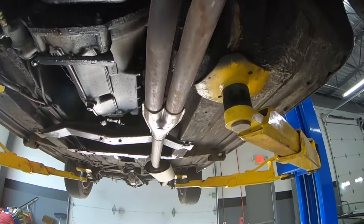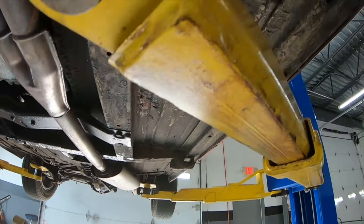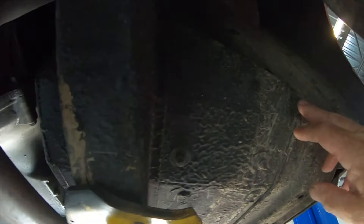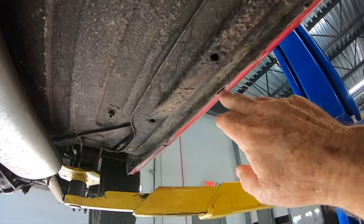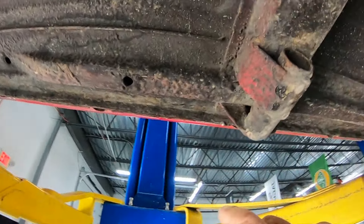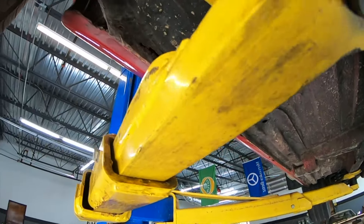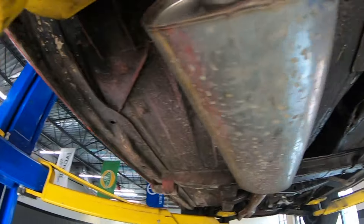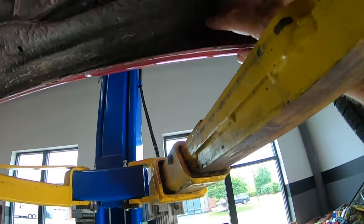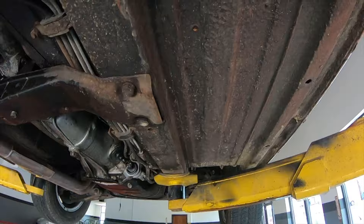We're on the underside of the MGB. It looks pretty solid — so far I've not seen any indication of rust. This is a rust-prone area here and it's solid. Still has the original MG undercoating here. All these drain holes are open. Jack point is solid. There's just a touch of rust right here — not bad, this is a pretty rust-prone area. The other side is good and solid. Good jack point, drain holes are open. Floor boards are original and they're solid.